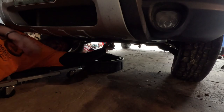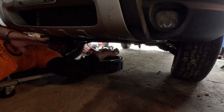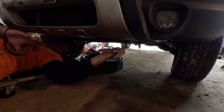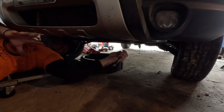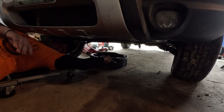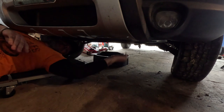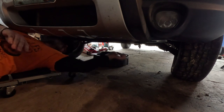Alright, so same as I've said in previous videos, there's no need to really torque down this oil drain plug too much. You just get it finger tight and then just snug it up after that. A little crush washer that's on it will seal it up nice and tight. No need to, you know, give it 47 Ugga Duggas to tighten up an oil drain plug.